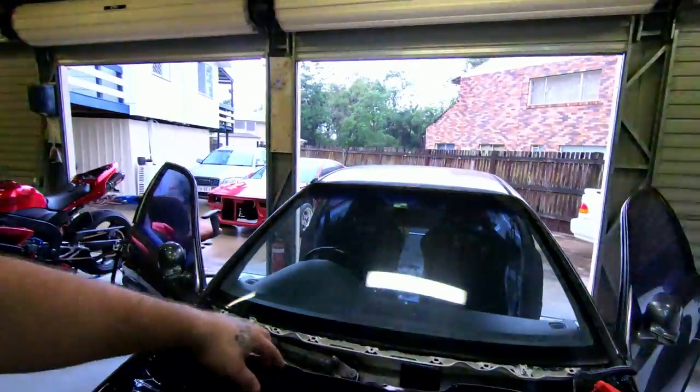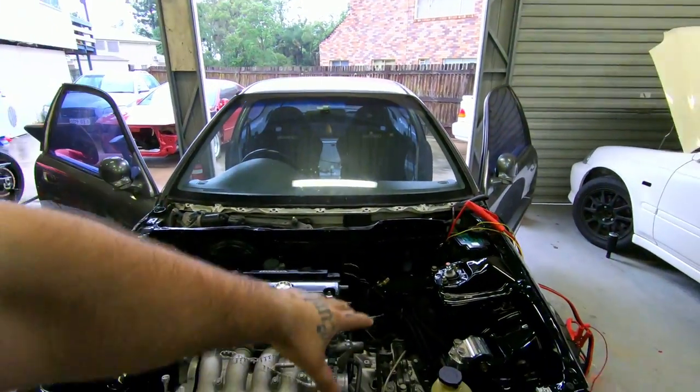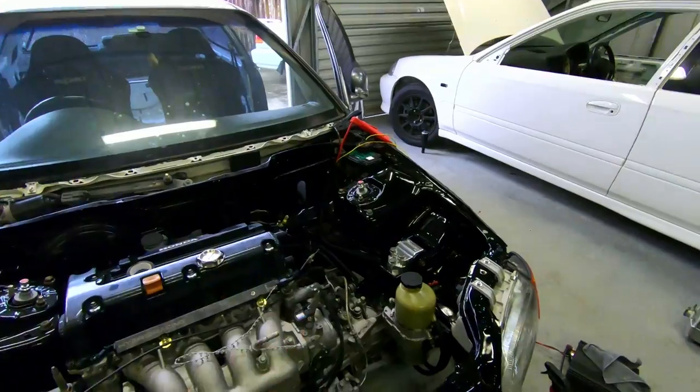Just don't do what I did and waste fluid by having to swap them around - you'll know they're the wrong way around because the steering wheel will fight you or do some weird things, and it's almost impossible to bleed it that way too. So high pressure to the bottom, return from the top - now it's all in, bled, and running full of fluid.